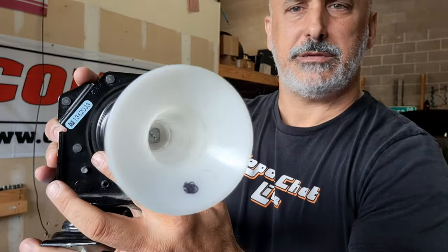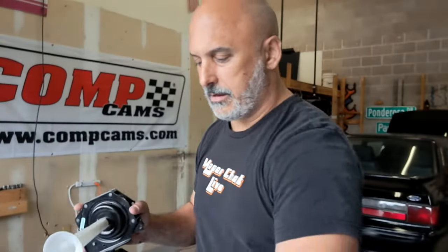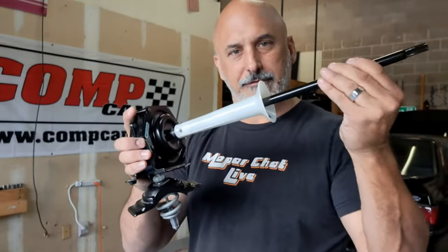Let's talk about the mechanism, because you may not have had the back tire out from underneath the bed yet. This is what that mechanism looks like. When you're underneath the truck, remove the cover and you'll see this bell mouth looking right at you. Turn it counterclockwise to lower the tire, and clockwise to raise the winch back up. You can see the little adapter in there — that is where the female end of your extension will slot in. You'll feel it make positive contact, then go through the process of dropping everything down.